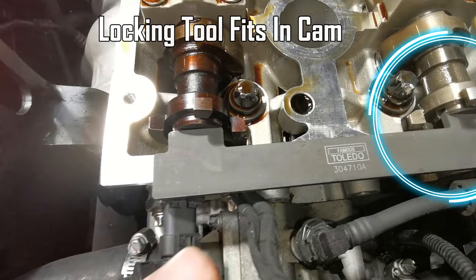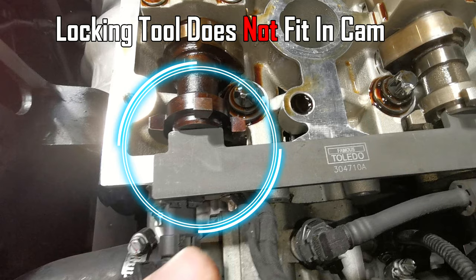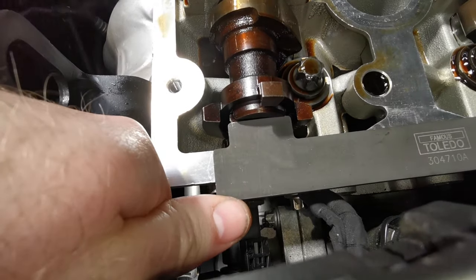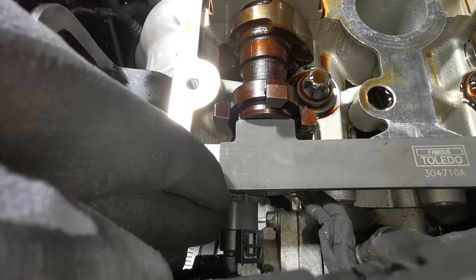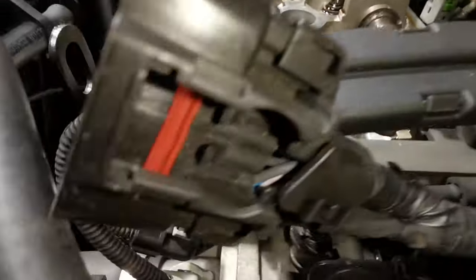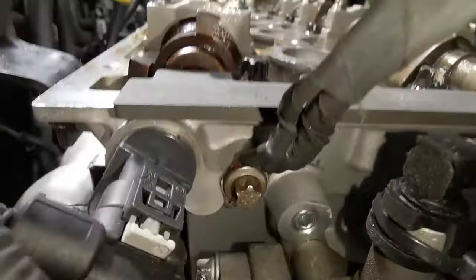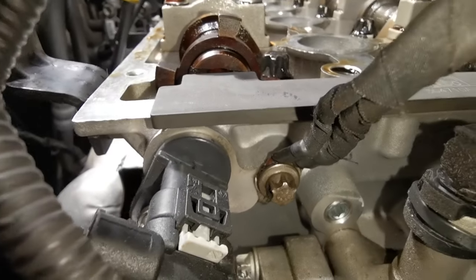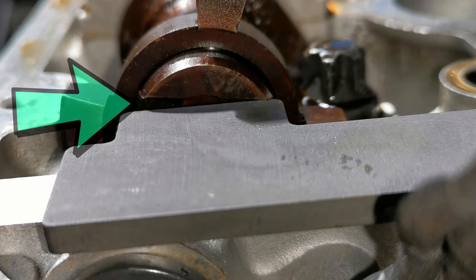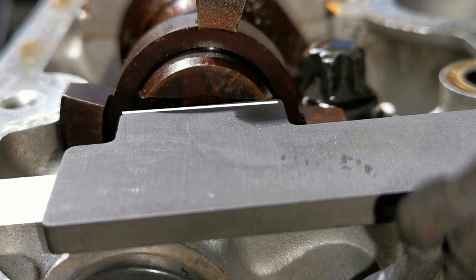Let me show you this vehicle with the timing out of alignment. This one had cylinder head work done on it, which meant the camshaft adjusters were removed. When I first checked the timing with the rocker cover in place, the timing was actually okay — everything was lining up like it should. But when I had the rocker cover removed and that locking bar put in at the rear, it wasn't capable of lining up so that bar would not go in the correct position on those camshaft lobes. As you can see with these close-up shots, it is out — and considerably out of timing on that left-hand side as we're looking at it.